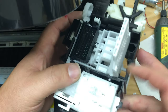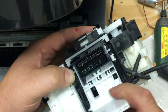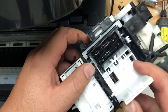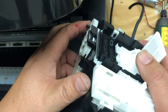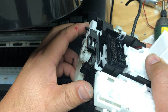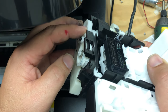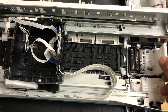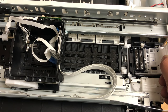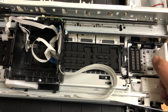The reason is there's a lock right here. See this stick? If it goes into the wheel, this one doesn't move at all. So you need to move to the right a little bit to release this inner wheel. So now it's turning. What we need to do is move this to the right a little bit. Now if you turn it counterclockwise, it's going to lock the printer. If you turn it clockwise, it will release the lock.